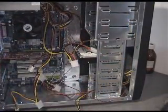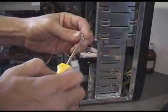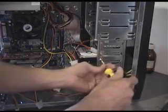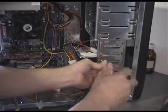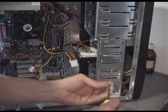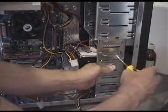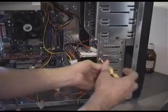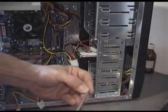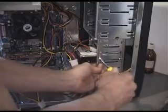Okay, so another couple of these little lipped screws onto the screwdriver with a bit of blue tack, and just screw that in. And I'll try one of those dome-headed screws now, actually. Yeah, that's what I use, the dome one. This lipped one, forget that. That's not working for this hard drive. The thread's wrong. So I use the dome-headed screws. Okay. So a couple of those screwed in like that, and that's enough to mount our hard drive.